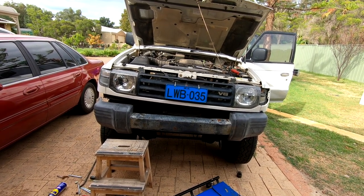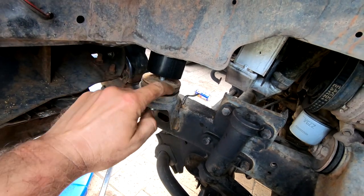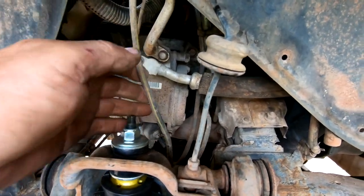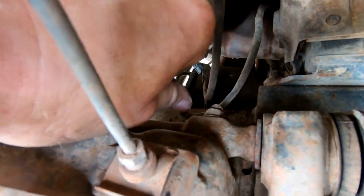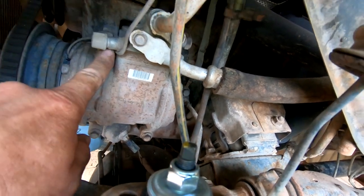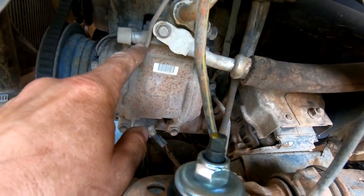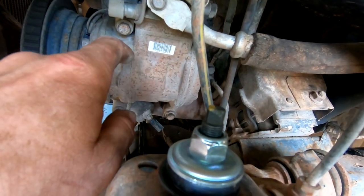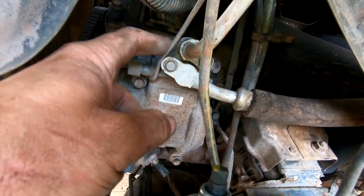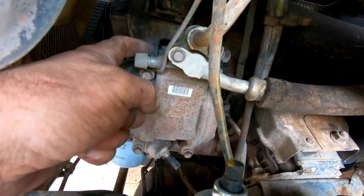Something to note on this side: because you have to jack the front up relatively high to get that one in, I've probably gone about an inch higher than needed. This earth wire was tight — fine, it's a good strong wire and pulling it slightly has made it slack. However the AC compressor wiring kind of hooks under the port there, and mine's hooked under — that wire has gone very tight. Hopefully my AC still works; if not I'll have to follow that wire up and check if I've damaged it. Maybe just check this before you jack it up and move that wire around the top if needed.